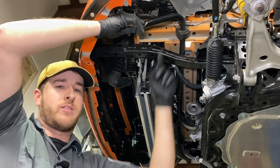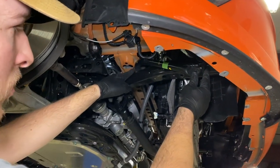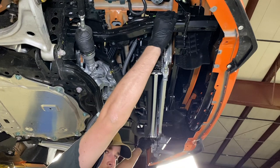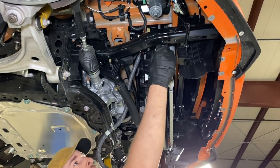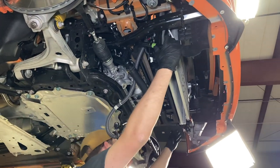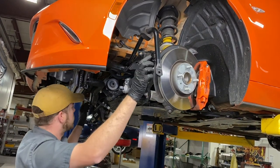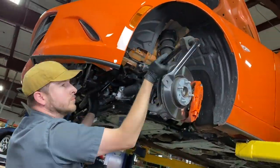We are going to end up pulling the bar out of the driver side wheel well. The biggest thing you are going to fight against is this bushing wanting to squeeze through this narrow way. Our goal is to get this arm up and over the frame rail next to the radiator. Be careful of your arm over here as it might want to start snagging on some of these wires for the DRL. Now that we are up and over, we might need to shift the radiator — it is flexible to a point. Now that arm can drop down. Our goal is to get the bar out of the wheel well, moving it in that direction and keeping an eye on where the ends of the bar are so they are not damaging anything. Voila!